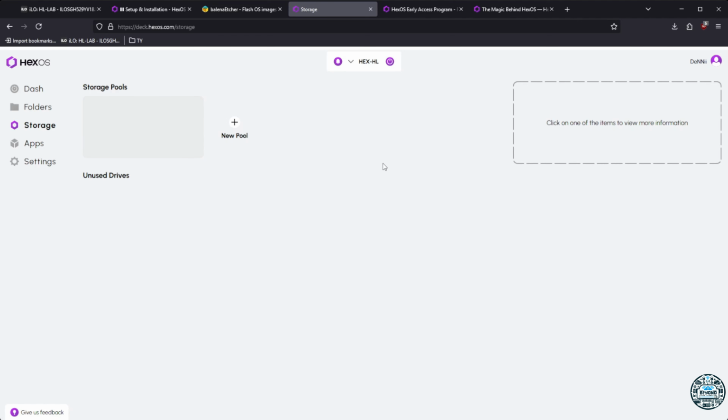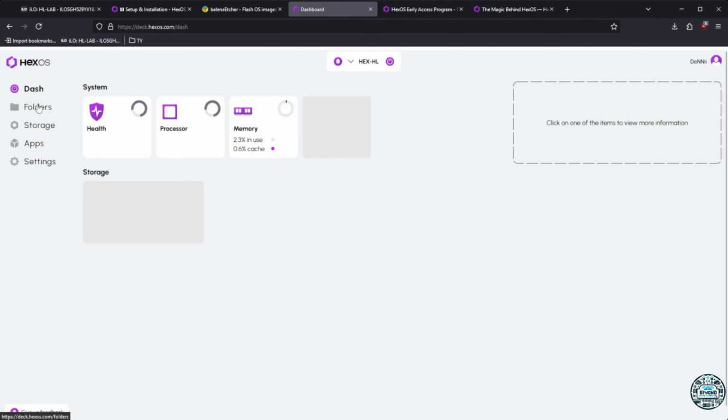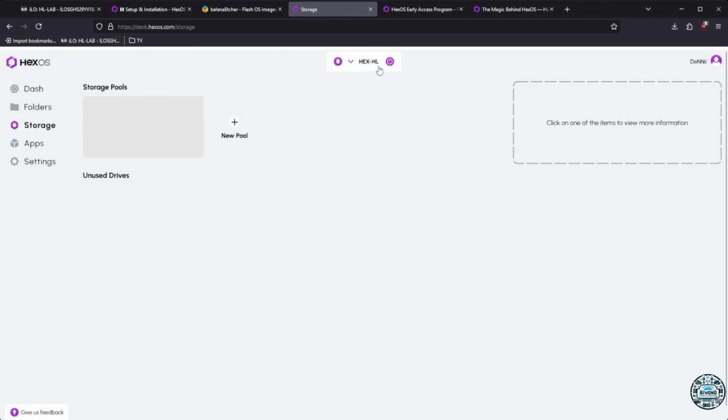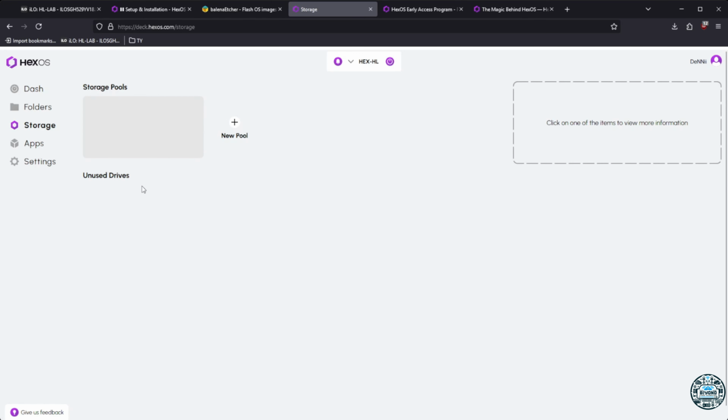I'm going to pull the SATA SSDs out. 2, 3, 4, 5, 6. Okay. Let us restart the whole system. Okay, the system just restarted. Let's have a look. I have unplugged the SATA SSD pool, and I'm curious if our normal pool will show up. Not looking promising. No storage pools present.